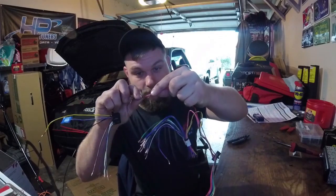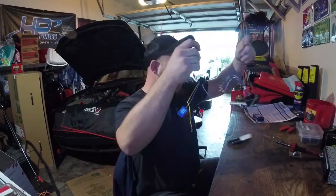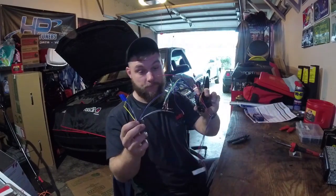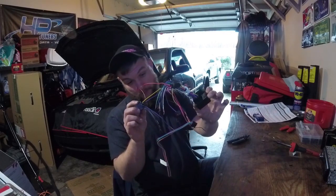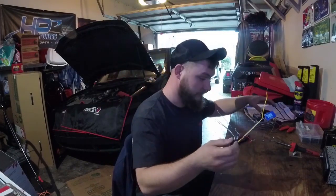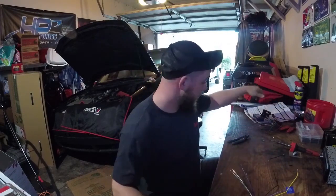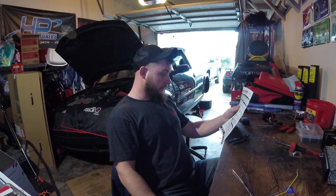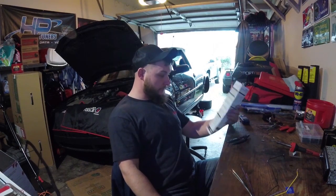We're only going to have about a half inch of connection here that's soldered. So if we need to snip this out and fix some stuff, then that won't be a big deal, because as you can see, this whole bundle is going to have about this far to go from radio to interface in the actual car. And we got this much wire, so it'll be plenty if I have to cut some stuff and redo. And we are going to use the old manual here, the instructions. That way we know exactly what year vehicle we're wiring, which wires go where, and which numbers we need to program the little device to.